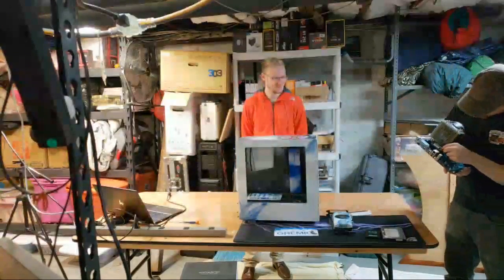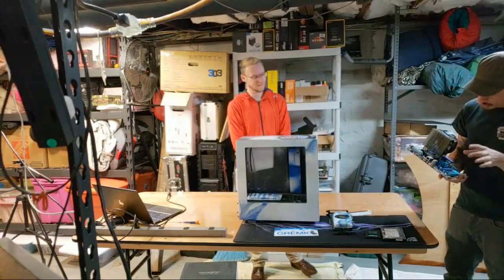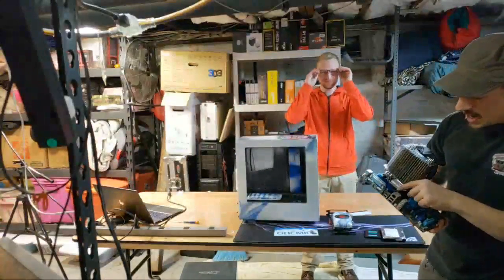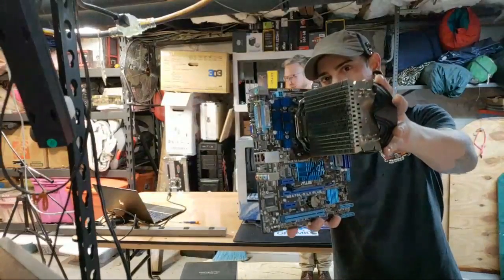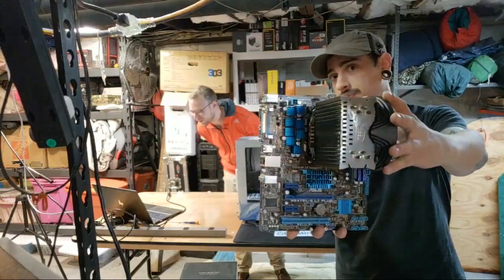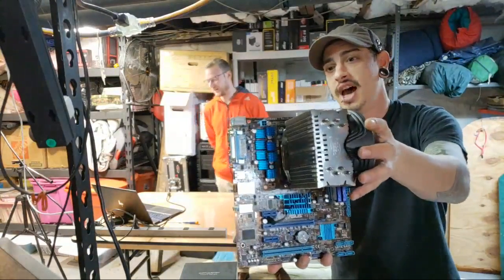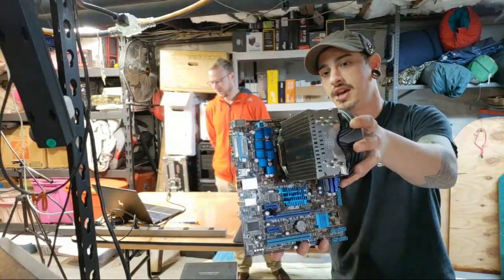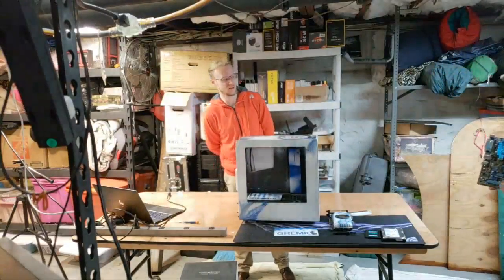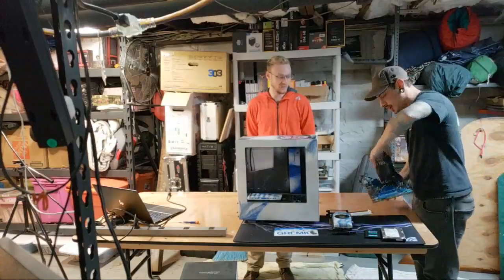And now another modification I want to show that we did to this board. This was another area we did spend a little bit of money just to make it special above and beyond. We added the aluminum heat sinks. I'll let you know what it's in the chat. Can you see it? Let's see. Turn it a little bit sideways. There we go. And yes. So all those blue aluminum heat sinks have been added to the MOSFETs and the chokes, which during our testing were getting hot. Yeah, we're absolutely getting hot because there was no thermal solution on them whatsoever.